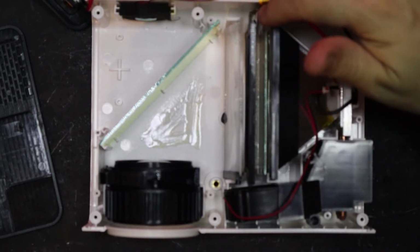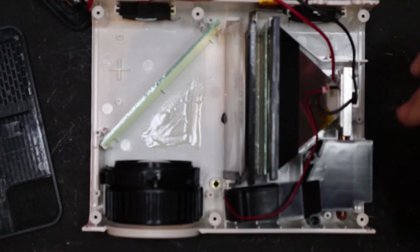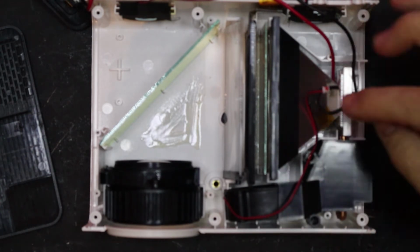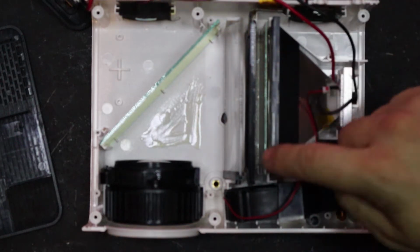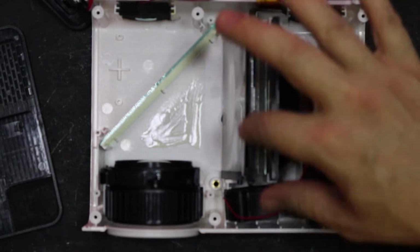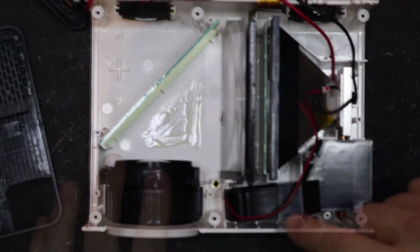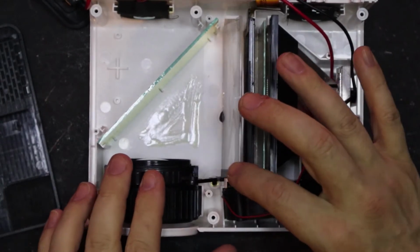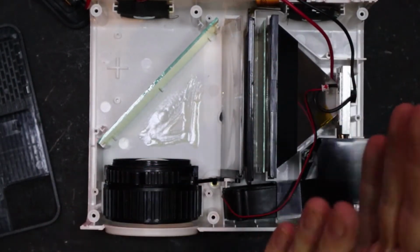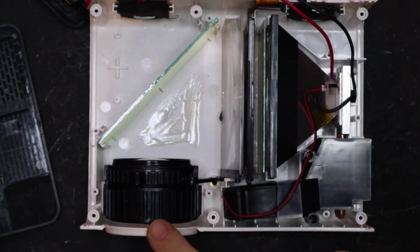And the screen is here, and basically, just like a normal monitor, just without any of the backing or any of that stuff. So the light is fired straight through the screen to another lens and another piece of glass, then through another Fresnel lens, which you can use this here, would move this lens up and down to change the pitch of the screen, hits a mirror, and then straight through the lens, which you can focus just here.